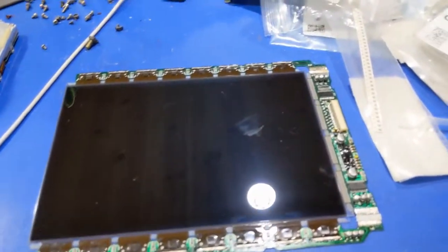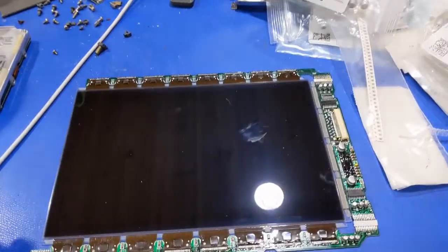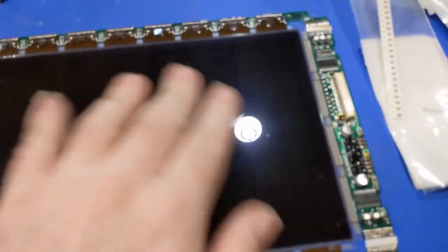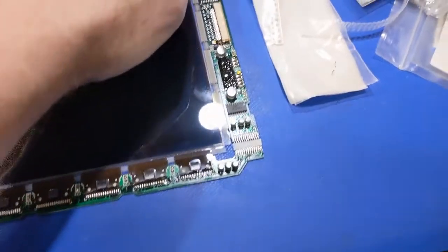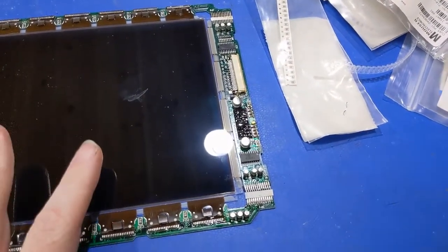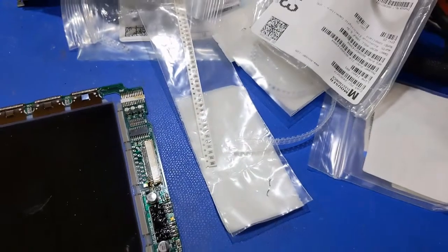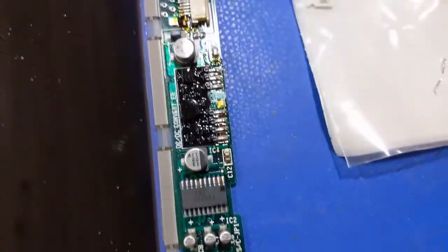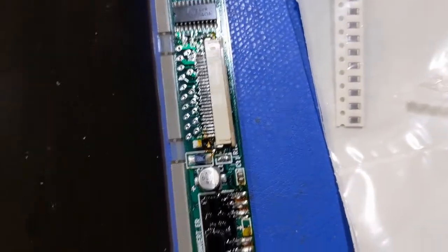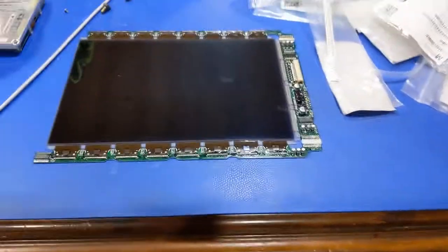I got the screen out now. It's real easy — once you have the screen, you just take the screw out of this and bend all these tabs out and the whole metal plate comes off, and then you can carefully remove the screen. What we need to do is start recapping this. All of these PowerBook 145, 140, and 170 all need new caps in the display. I don't have the exact ones on hand, but I can probably mix and match. We have 3.3µF at 35V, a 22µF at 35V, and then 100µF at 6V, which I have. So we're going to go ahead and get this guy recapped.